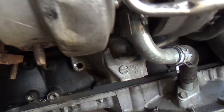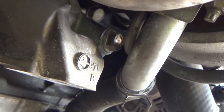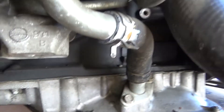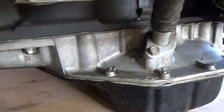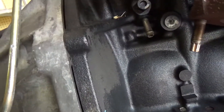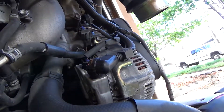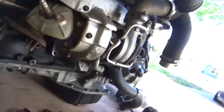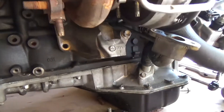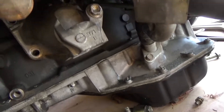So to get this all off you've got to take off these stupid motor mount bolts — there are four of them. I'm pretty sure you have to remove the turbo drain to get through this one. I'll mess with it and see. I know it was a bitch though. These motor mounts — I just got to take them off. This is the first one I got with a tranny on it. Normally the importer will do all this work for me, but I'm gonna take this off on each side. The exhaust, downpipe, stuff like that to get to these motor mounts. This one is a bitch, so you have to take off the turbo feed and return. Make sure it's a 14 six-point — if you use multi-point it will strip. That's what happened on that one.